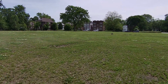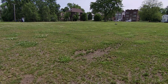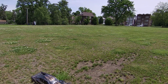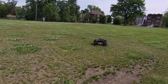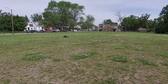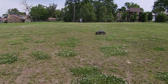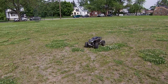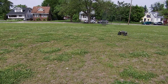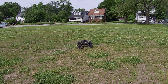Of course, that front CVD that runs into the output cup for the front diff, I hate that thing. But it's sorted now, so I'll deal with it. I'm still wondering why they just didn't have it as a dog bone. That would have had no problems at all if it was a dog bone. But they had to make it a CVD.